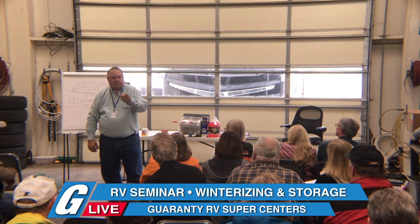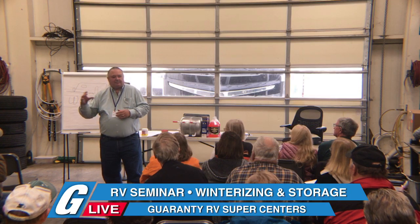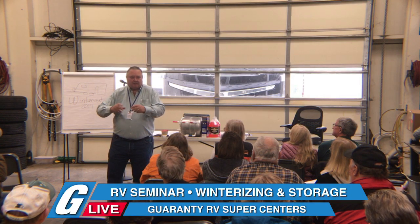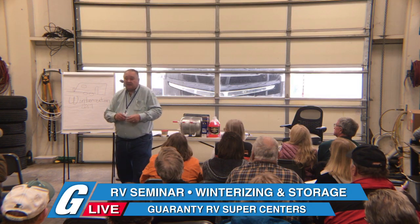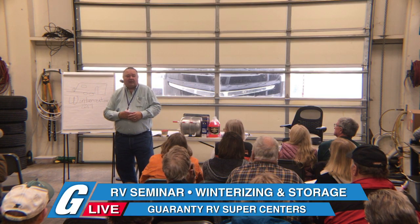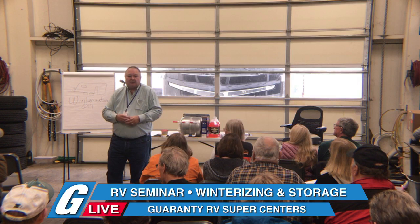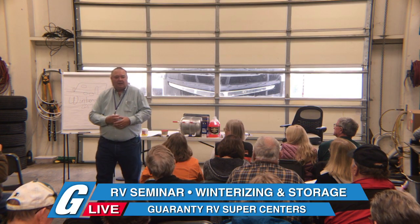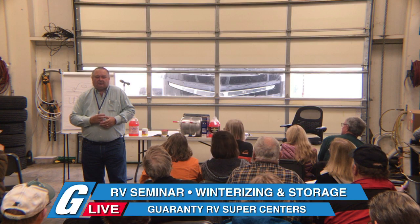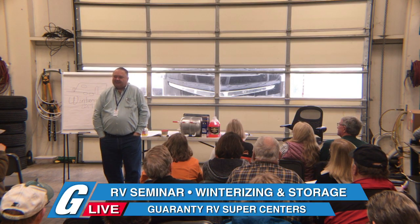We do, and this is a good point actually. We have had an occasional problem with that cracking, because sometimes when you're running the pump dry, it doesn't pull everything out of that, and you can just turn that filter 90 degrees and it'll come apart. Occasionally, we don't get everything out of that. One or two a year, and we do 1,000 a year, might be actually cracked, because they're just a little clear plastic. There's no pressure, it's just a small plastic filter. But it's okay to turn on your water pump until no more water is coming out, then turn it off. Like I said, one or two a year may not get all of that water out, but it's not that big a deal.